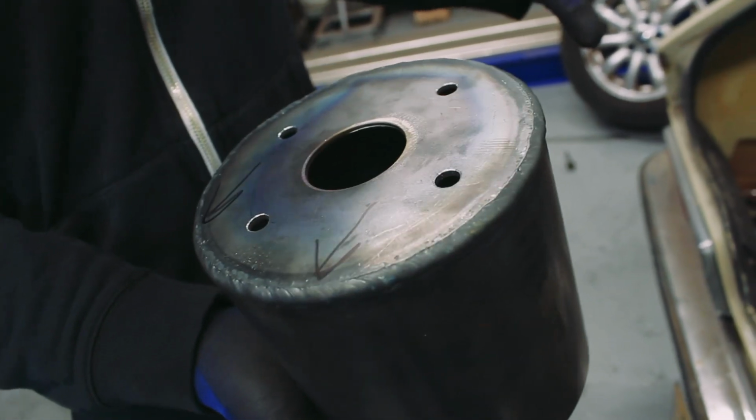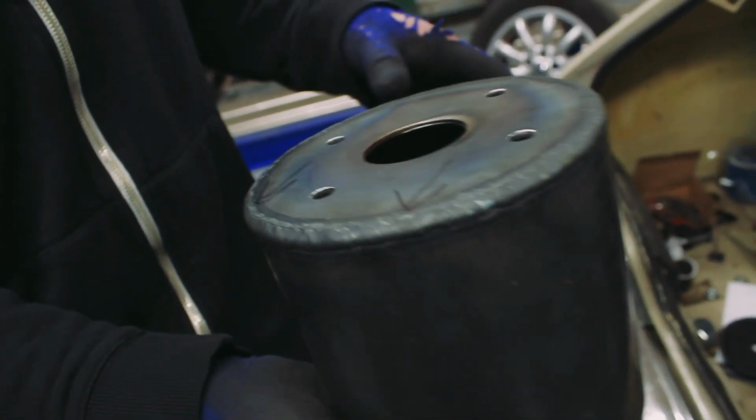Once we've got the jigs bolted in and the strut tops on, I can then start thinking about how I'm going to connect these up to the front and rear mounts for the subframe. At the minute, we're still on fairly temporary rear mounts with just that bit of box section across the back. Yes, I've beefed it up, but that's obviously not how it's going to stay.